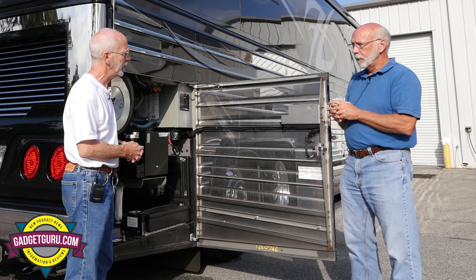We're also checking belt tension. The phrase I'd use is 'piano string tight' — you want your belts tight. Some of those belts have their tension put on by airbags, so what we're really checking is whether those airbags are inflated. While you're pushing on those belts, you're also looking for cracks, and on rib belts, pieces of rib being missing — things that look unusual. These are brand new belts; we had them put on at Prevost. We basically brought everything up so we now know all our service intervals.